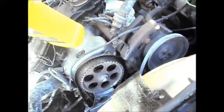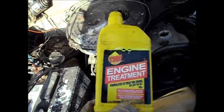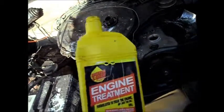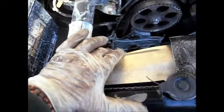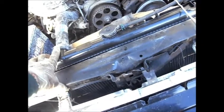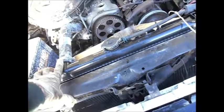I'm going to give you a little tip about this Duralube stuff here — it's pretty good stuff. It was recommended to me by my mechanic. I believe in it. The radiator that came is a little bit bigger than the shroud I had, so I had to modify the shroud a little bit and put a spacer in there. Hopefully with the new radiator I'll be able to drive at least 30 miles without any problem.